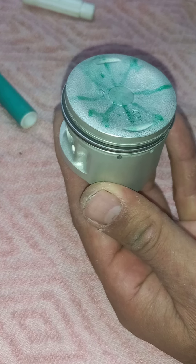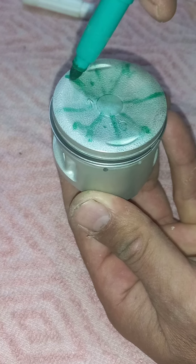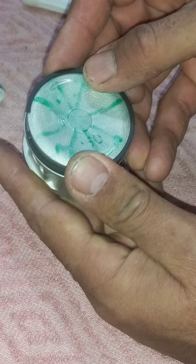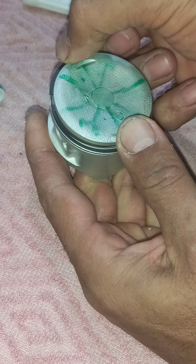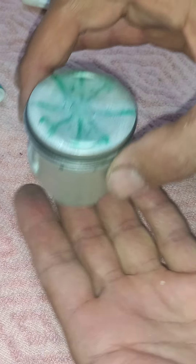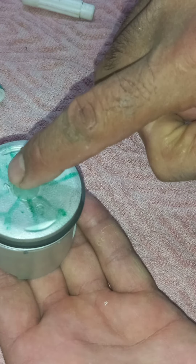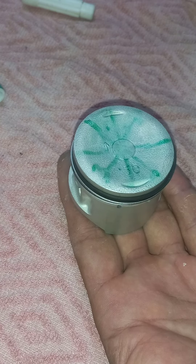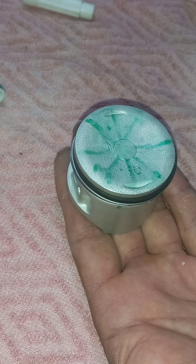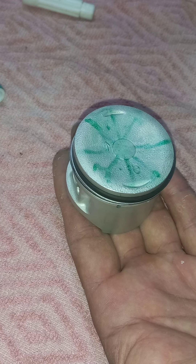Now I will take the top ring with the R mark. The book says the top ring is in position one — which means here. I do it like this — R mark here if you saw it — gently and nicely with no pressure. Now I take the piston and install the pin with the clips, with the arrow going to the exhaust. In the next week I will show how I do the overhaul, because I'm going to send the cylinder to boring. Thank you very much and have a nice day.